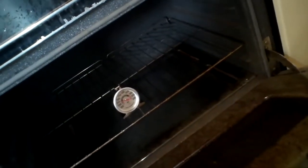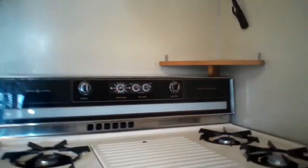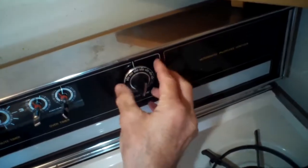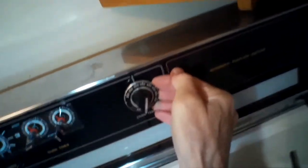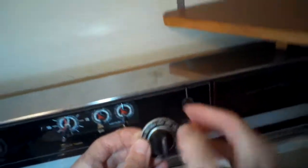You can just see how the temperature is doing. So this is asking for 300 but we're only showing 250. What you can do to adjust it — pretty easy — just pull this off, pull it back towards you. It takes a little bit of pressure; I usually use two hands. And on the back of these GE ones, pretty cool, you have two little Phillips head screws.